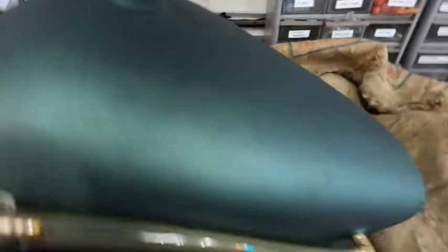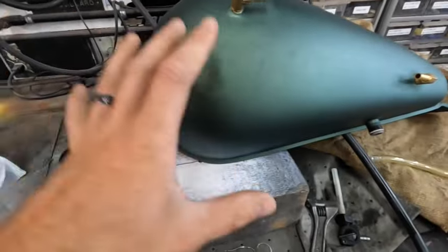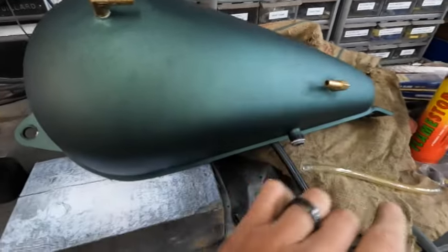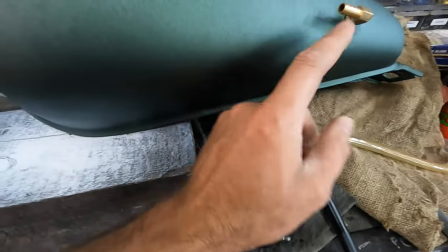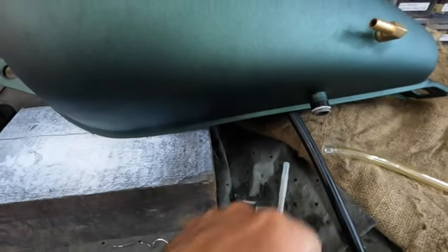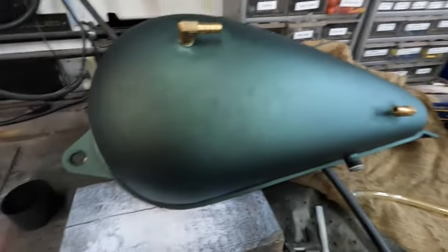It's a lot of moving and shaking to get all the sealer in there. Now that it's completely drained out, we're going to rinse it before we hit it with the degreaser. We've got our tank empty and stripped down, with a sight glass here for our fuel line. You want to take your petcock off, fuel line off, anything you don't want to come in contact with any of this product. You can tape up or plug off your ports — just keep in mind if the product settles in these areas it'll clog your port, so let the extra run out.